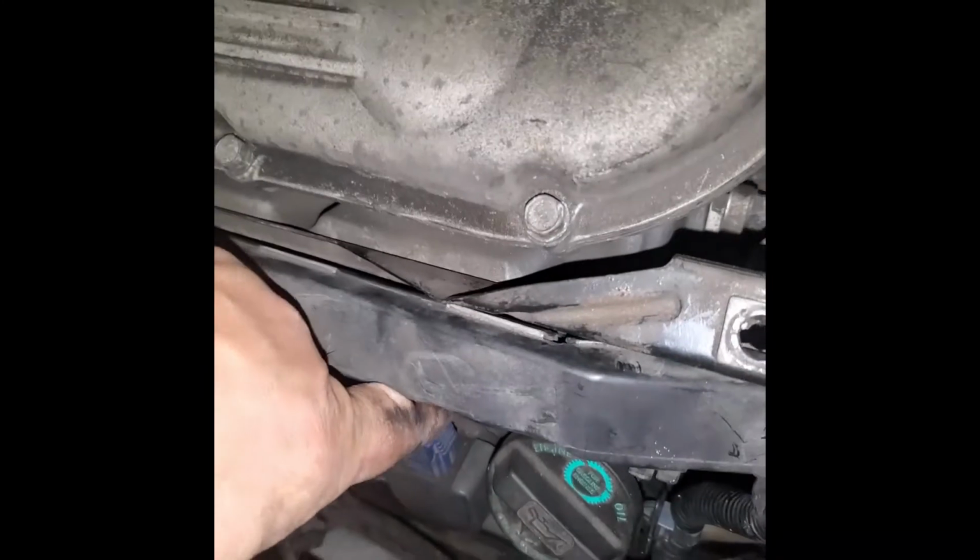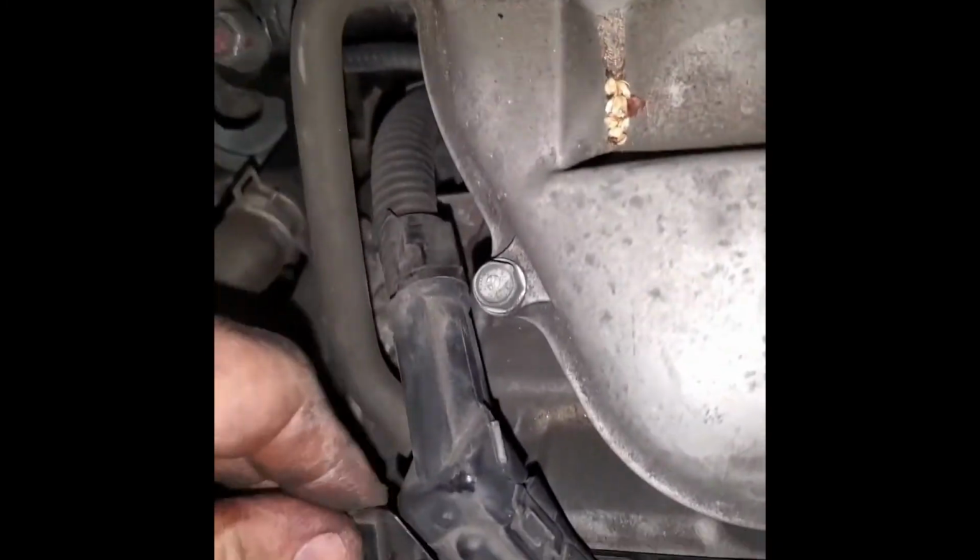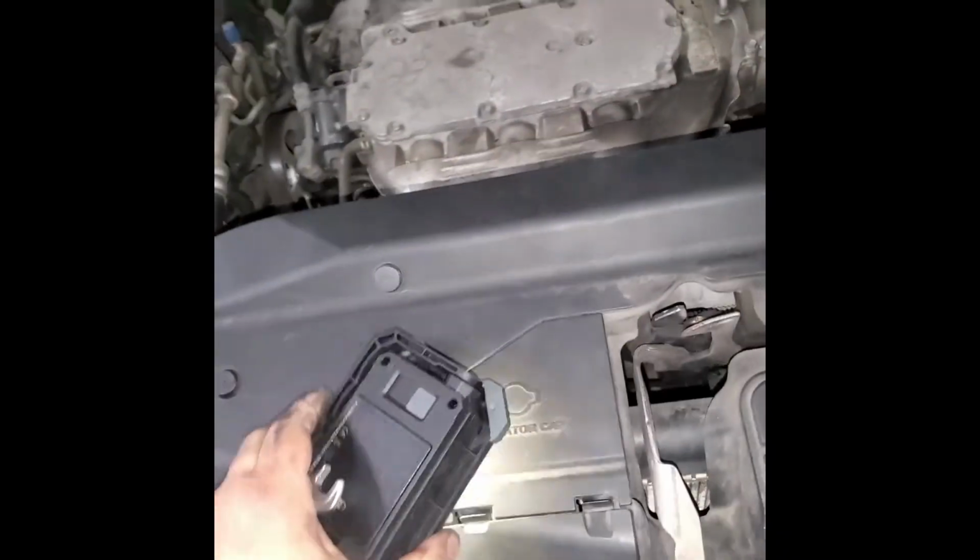All right, injectors are in. I heard the click on each one of them. Click, click, click. Make sure the oil cap is tight. This bracket is not moving anywhere. PCV valve is in place, as you see. And remove all your tools from the car, from the top.